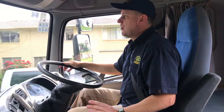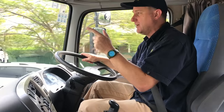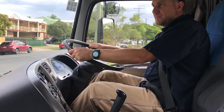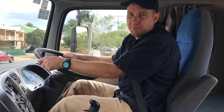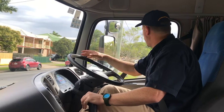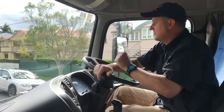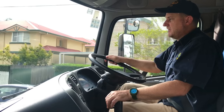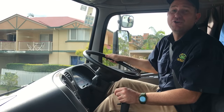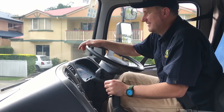When coming to a stop with a Road Ranger, car drivers tend to pop into neutral while still rolling and try to select gear — that doesn't work with these gearboxes. What you want to do is keep it in gear until you're completely stationary. Once stationary, pop it out of gear and into the start gear, then take off. My foot's on the clutch but not engaging the clutch brake — about an inch or two off the floor. Keep it in gear until fully stopped, then pop to neutral, select gear, and go.